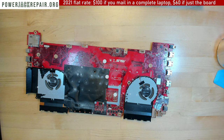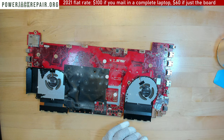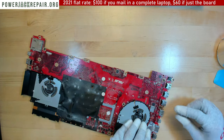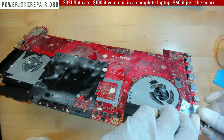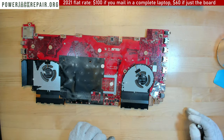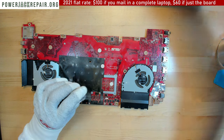We, by the way, sell the component for this laptop. It should be on our website. The link should be below. And hopefully the sizing of the component is the same. Good. So what I'm going to do is desolder this connector. It's going to drop from the motherboard and we're going to solder a new one in. So let's switch to the soldering station.